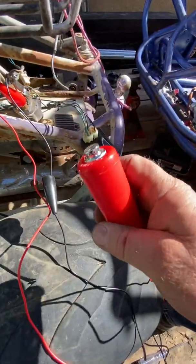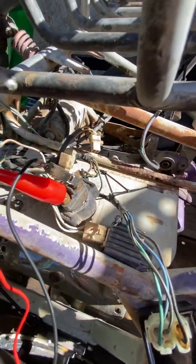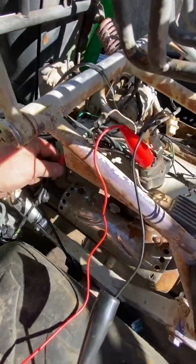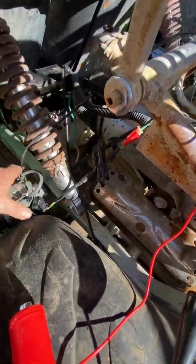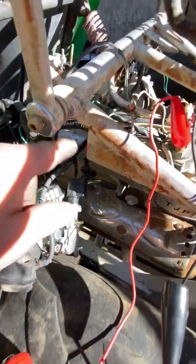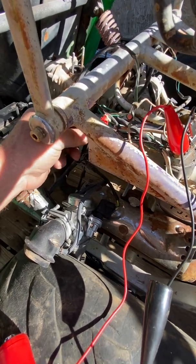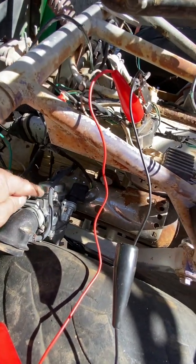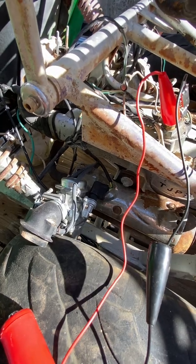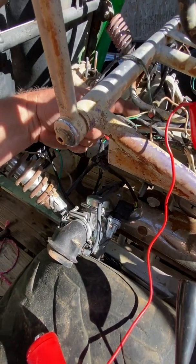You have your power wire that comes off the battery — your positive and your negative, green and red. They come up here and you've got your main wire that goes from your battery to your starter solenoid. I've got a starter button on this because the starter solenoid is bad, which they normally do go bad from people trying to start them when they can't figure out what's wrong. Then you have the wire that goes to the carburetor — this is your automatic choke. It's got to be wired into 12 volts somewhere. It's not a special wire; it just needs power going to it so it can automatically open the choke. It senses it from the carburetor, so it can be wired anywhere into the wiring harness as long as you've got power going to it and it's grounded.